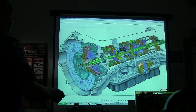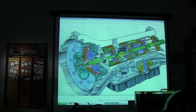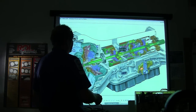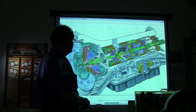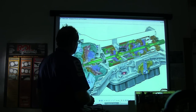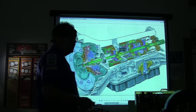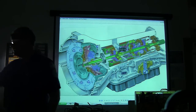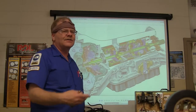What's this part right here? Someone guessed a shift solenoid, but that gold-colored part is actually the neutral safety switch. This right here is where your shift solenoids are, down in the panel. Like that little Dodge Stratus we were talking about — on that one the shift solenoids are on the outside of the transmission.